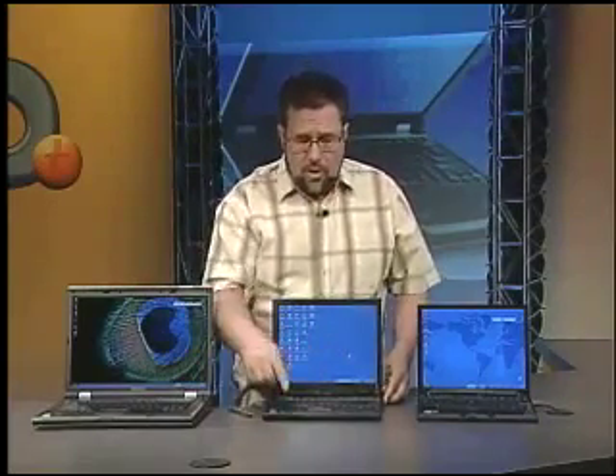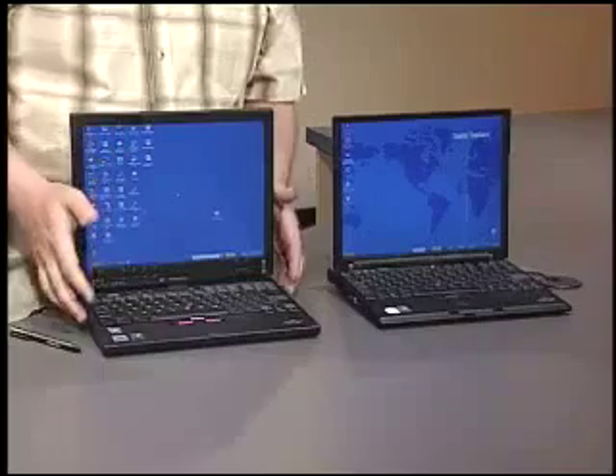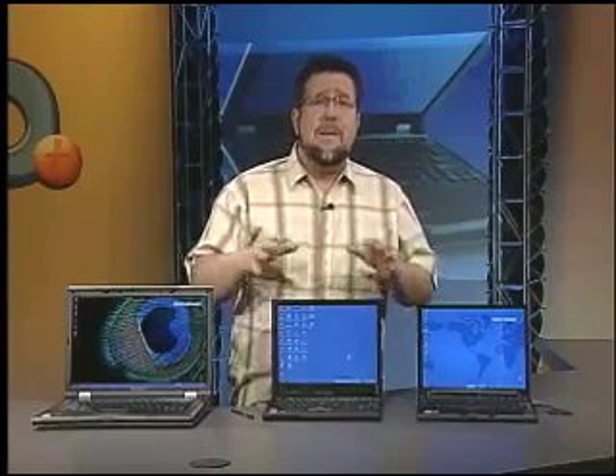You'll want to plug in an external speaker or headset for serious audio. All three models have fingerprint readers to prevent unauthorized access to data. This is a special fingerprint reader — it's not just looking for fingerprint patterns, but it has a capacitance sensor that looks for an electrostatic charge in the living tissue of your skin. That means, Mr. Bond, if someone manages to cut off your thumb to gain access to your data, they will fail because there will be no electrostatic charge in a severed thumb — and that should be comforting. These computers are also built to higher specs, with hard drives featuring built-in shock absorbers and accelerometers that detect a drop and park the drive head to prevent damage.